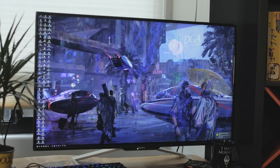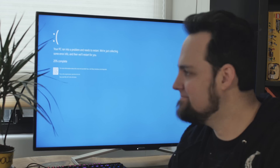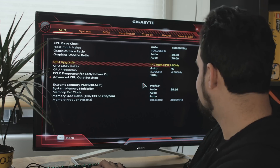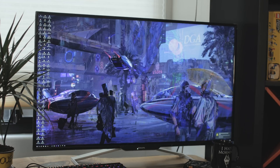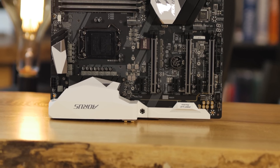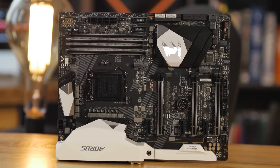We rebooted and it got into Windows — so 5GHz kind of worked. We tried 4.8GHz as well. Out of the box the board does a really good job of overclocking just by clicking a couple of buttons. The 7700K is an easy-to-overclock part, already clocked at 4.2GHz stock, so hitting 5 doesn't seem like a huge deal and there's already a preset for it. However, we blue-screened a couple of times with the preset, so I had to go in and bump the voltage up to around 1.4V before seeing stability at 5GHz. Even then it was overheating a bit, so load line calibration may need tweaking.